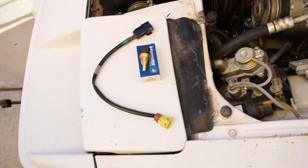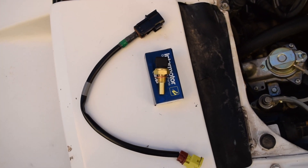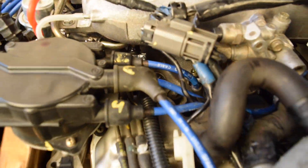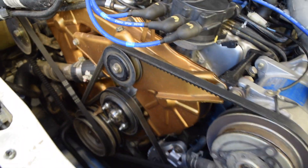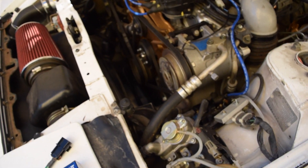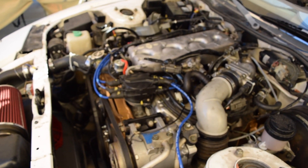Basically what we're doing is we're going to put a new CHTS sensor in. You can see I've got my new one right there, and it goes into a little plug right on this side. The standard CHTS is right under here in the timing and it's hard to get to — you have to take the timing off or dent your timing cover. And you have to replace these every so often or else your car kind of just doesn't work.